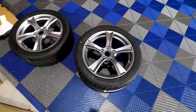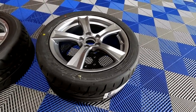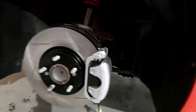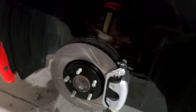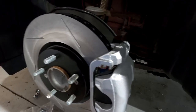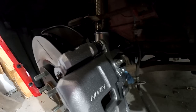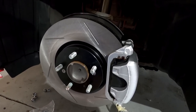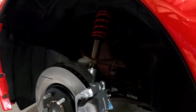That color is beautiful - they are going to look great against the red. For the calipers, you can see how nice they look with a nice black rotor. The caliper is done, the pads are all clean. I don't like to paint the whole thing the way some guys mask off the line and paint the entire caliper. This silver is applied over everything properly separated - looks nice. It's got all stainless Allen bolts. Still got to put the brake line in, flush, and bleed it, but the coilovers are in.